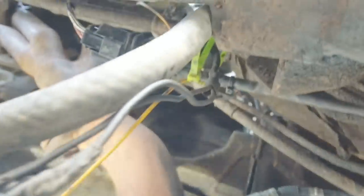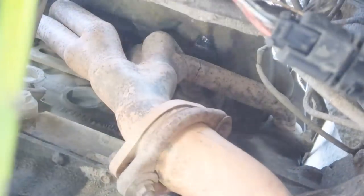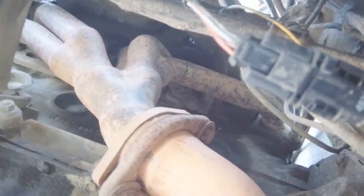So I think I found the source of my exhaust leak. I thought the header was just getting loose again, but it's a little worse than that. You see that up there? On that pipe that goes to number 6? Does it spray at all? Look at that! If I'm seeing that correctly, that pipe is cracked all the way through.